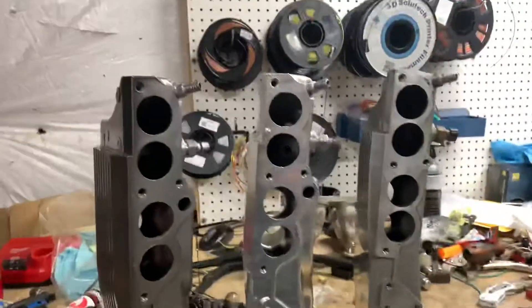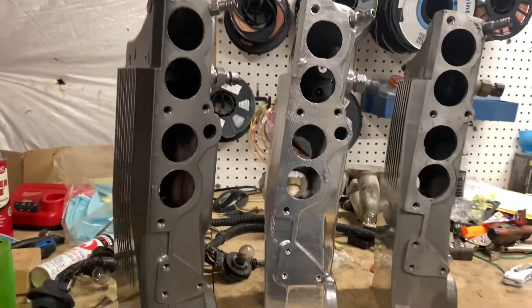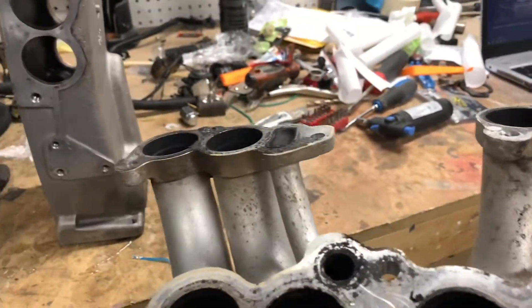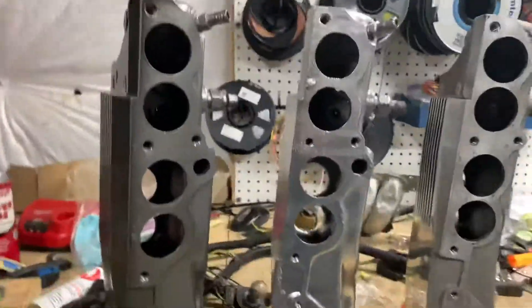If you delete the cold start, not a big deal — you can interchange them. The runners kind of have to match also. They have an additional tube, I think an EGR tube, but it looks the same on both sides. There's an EGR runner and a ninth injector runner, so you have to keep that in mind when you're piecing a setup together.